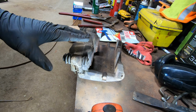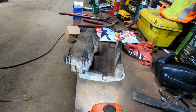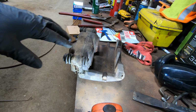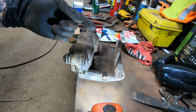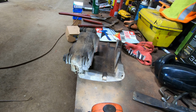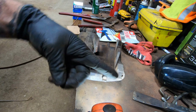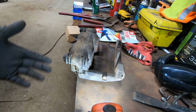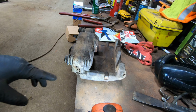It's gonna have to be perfectly smooth, so I don't really think you can clean that up without it leaking. So you definitely want a new piston if you're gonna try to rebuild it, and make sure there's nothing inside that groove where that O-ring is. Make sure it's all clean. If you got corrosion in there where that O-ring's sitting, the fluid might just come right around it and out. So basically, for the price of it, I don't think it's really worth rebuilding.